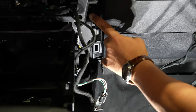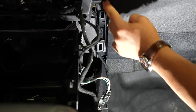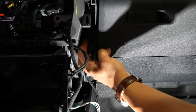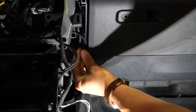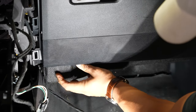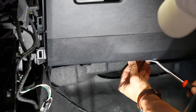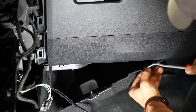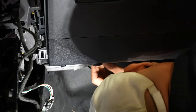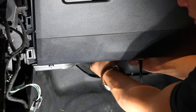With the harness popping out of the side between the glove box, I'll route it down and out of the way. You'll see slots here where clips and alignment pins go, so as long as you don't cover those holes you won't have any problems pinching the wire. I'm going to make my way over to the passenger footwell area — there's a fabric footwell cover held in with retaining clips. Use a panel tool to pop each one free; there are three of them. Once all three are popped out, pull the whole panel aside for good access to zip tie the line to the harnesses in there.